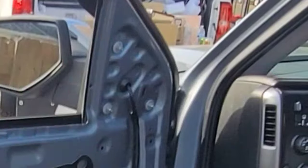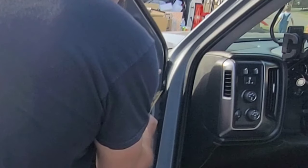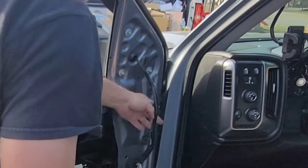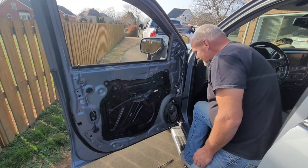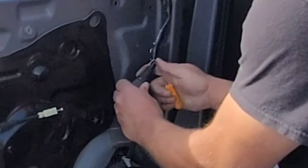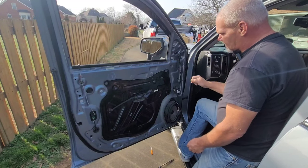One, two, three — the old mirror will come off first. We need to get the wiring harness undone. Come right up under here. Now all we have to do is unplug this — push the grommet back through — and the old mirror will come off. There's a release right there center-ways across — push that down, use the pick to help, and you pull against the plug and it just unplugs. That mirror is ready to come out. I'm willing to bet these are 10 millimeter bolts. I'll hold up on the outside of the mirror and just loosen it at first.